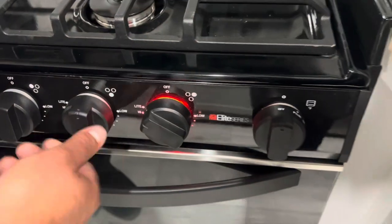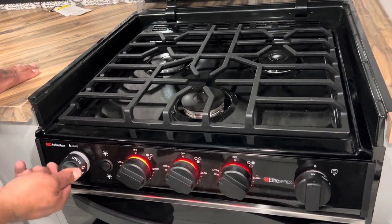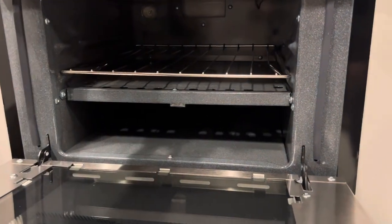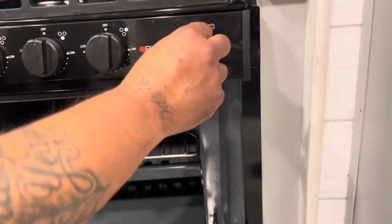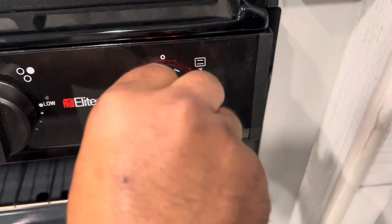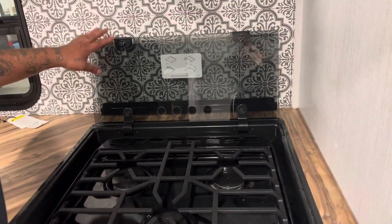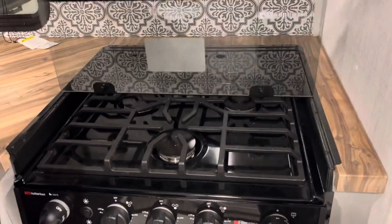You can see the dial — there's a notch that says off to light each individual stovetop burner, just like at home. Turn the dial to light and the red light turns on. You can do them individually. Once you do that, turn the ignition clockwise to ignite. It won't ignite right now because the propane is turned off, but with propane on, it will light every burner. Same with the oven down here — some ovens the igniter works automatically, or you may have to light it with the pilot underneath. To light the oven, turn to pilot, push it in so propane can come out, then light it safely underneath. Once lit, turn it to whatever temperature you desire. Once you turn it off, the pilot light will go off. When done with the cooktop, leave the glass up — do not put it down until the stove cools or it can still shatter.